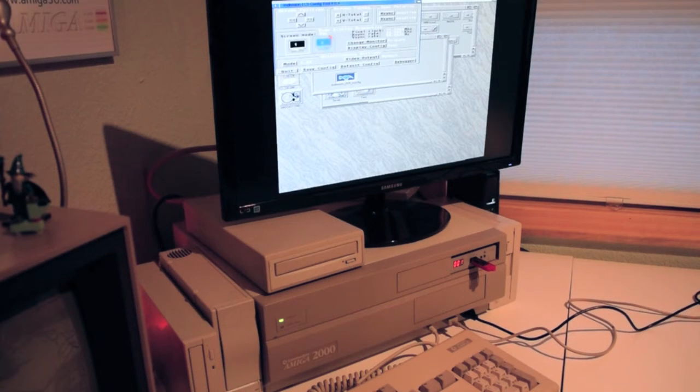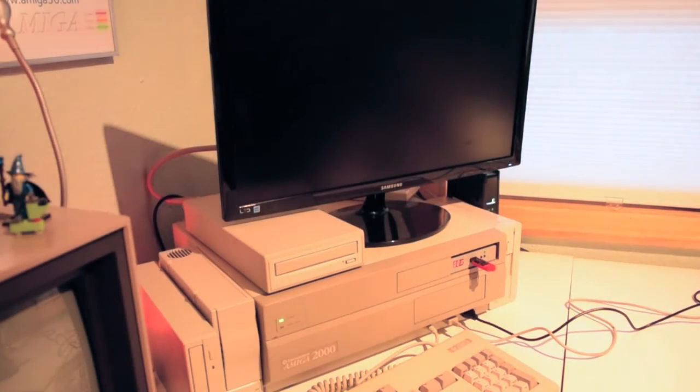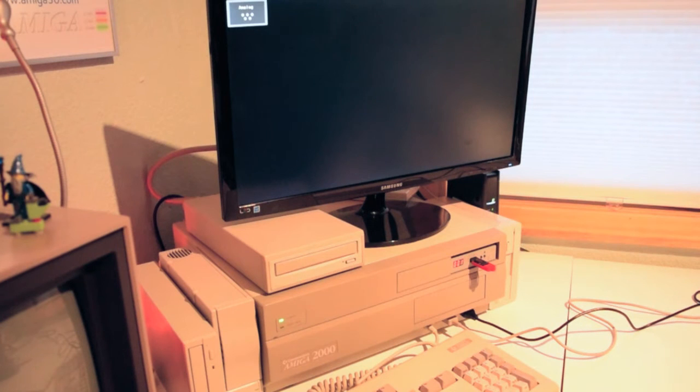The config file gives you a few extra options to trim your display. We have screen position and screen timing, which as expected let you adjust the total overall area displayed and the position of the screen within the monitor. To use those options, you need to set display config to 'user' as opposed to the internal FPGA's configuration settings. It's not much to see, but it gives a few extra options to configure the display.